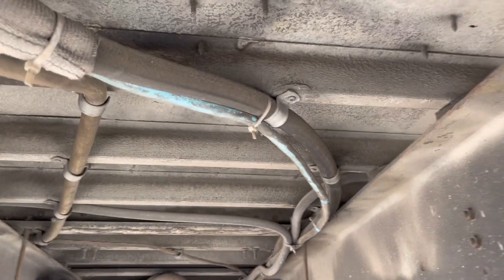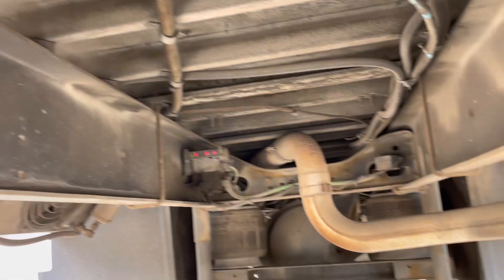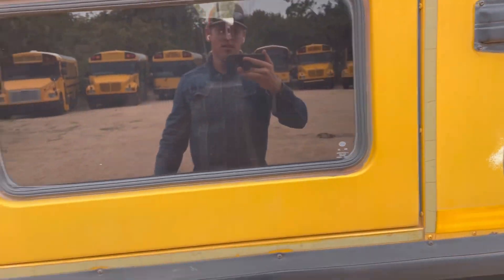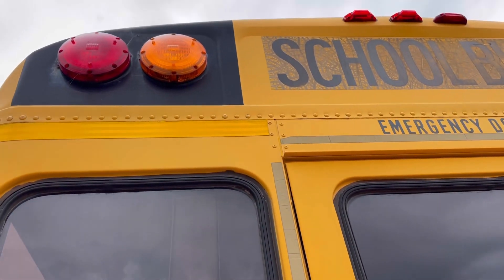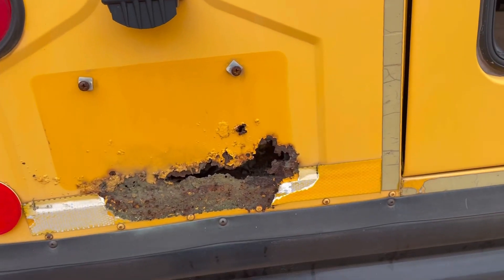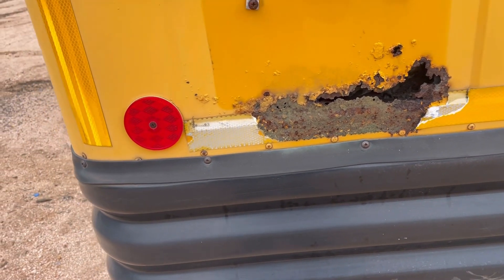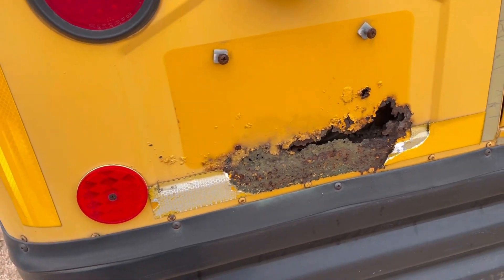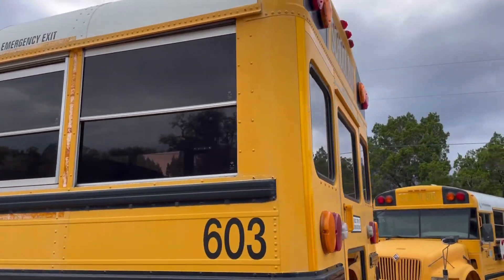You can check your underbody. A lot of times rust is most visible in the back — if you have rust, it's going to be really bad in the back area. This frame is super clean, like no rust. This one spot is because there must be a leak up top somewhere that's running down and water's been pooling at the bottom. It's not a huge deal — I'd cut out this whole section around the license plate, pop a new piece of sheet metal in there with some new rivets before doing any painting.